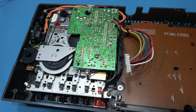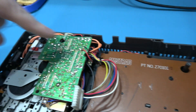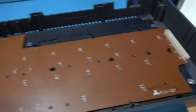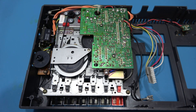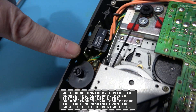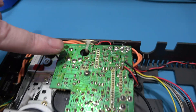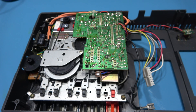To get the tape mechanism out, I first have to remove the keyboard. The power LED is under the keyboard and it's connected to the actual tape mechanism, so I need to remove it. I'll remove this screw, this screw, this screw, this screw, and this screw — and then the keyboard should just pop straight out. To get the whole tape mechanism out, I need to remove the power switch screws here and here, then the volume knob screws there and there, and finally the tape mechanism screws here, here, down in this hole, here, and the final screw here.